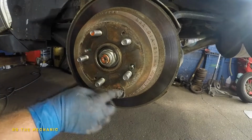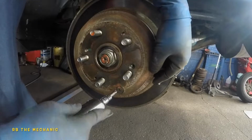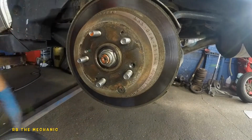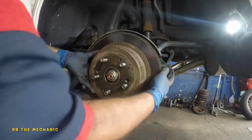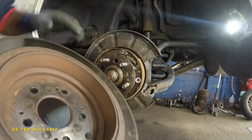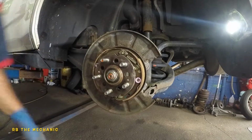Okay. Don't forget to take off this grommet. All you do is you get a flathead screwdriver. I don't have a flathead screwdriver, which I didn't bring. So this rotor sometimes can get jammed because you do have e-brake shoes inside. So bang, bang, bang a little bit here, but these are pretty free played out. And you want to push that grommet out of there, okay? Get that baby off. We'll put that baby in at the end.